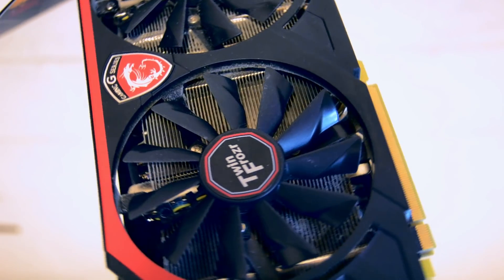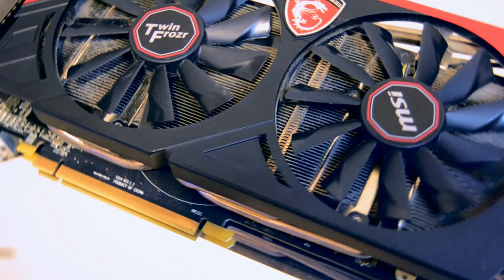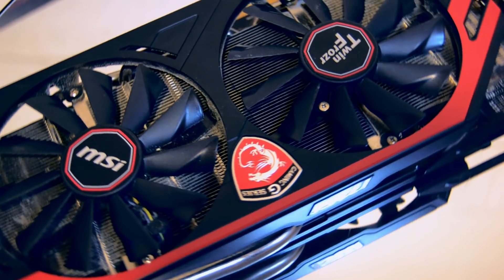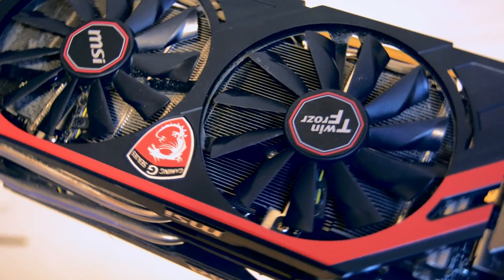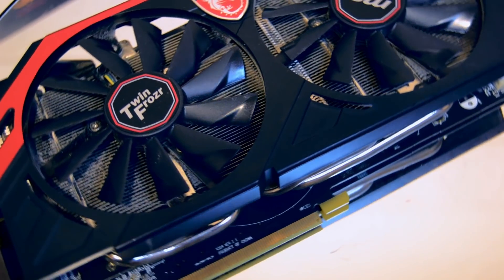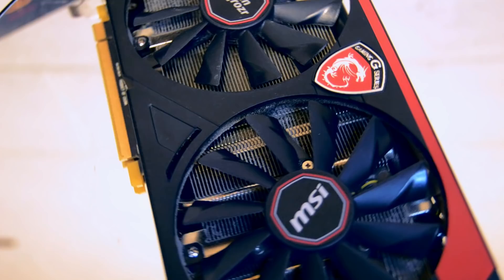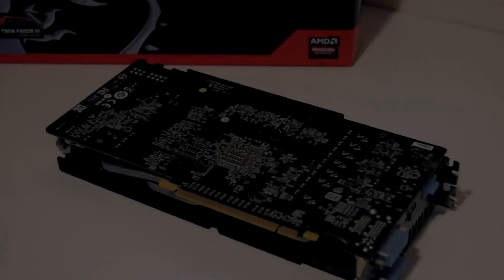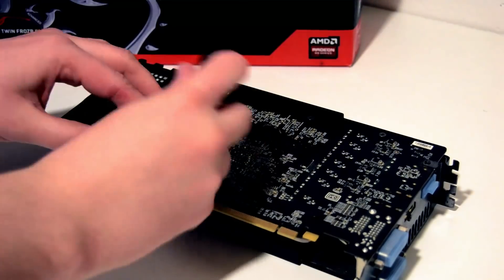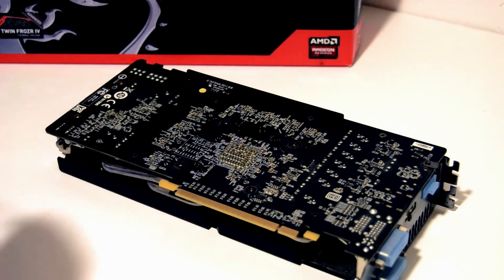But was it actually an underwhelming card and is it any use today? Before we answer that, we first have to fix this one — this MSI Gaming branded 285 2GB, 42 quid on eBay with a minor overheating problem at full load. Early testing showed that only one of the fans was actually spinning up, and as far as I'm aware on the Twin Frozr 4 cards both fans should be spinning at all times. Since the fans are controlled by the same 4-pin header on the PCB, this is pointing to a burnt out fan, with the other one likely to follow soon.